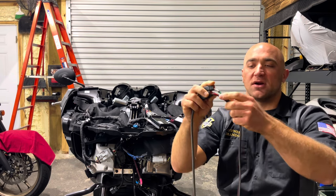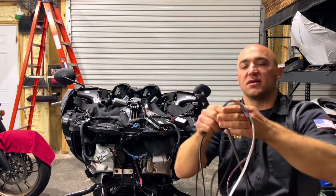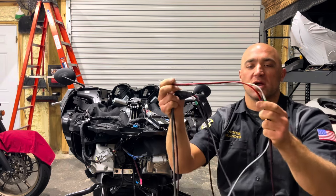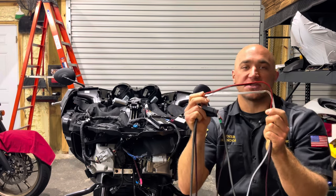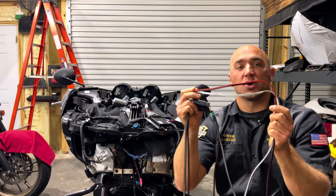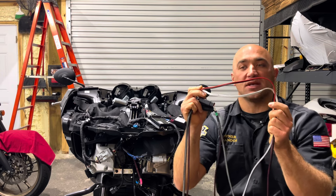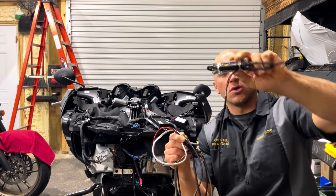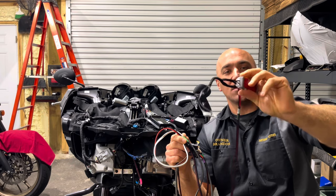And then from here, this is the part that goes to your saddlebag, exact same braided expanded loom, shrink tube, color coordinated. And we leave this long on this side on purpose, because depending on the speaker that you're using, if it has a crossover, you can cut this shorter and solder your crossover directly to it like we do for the passive fairing harness right here, for example. So we could cut the wire shorter, solder it into the crossover and go directly to the speaker.